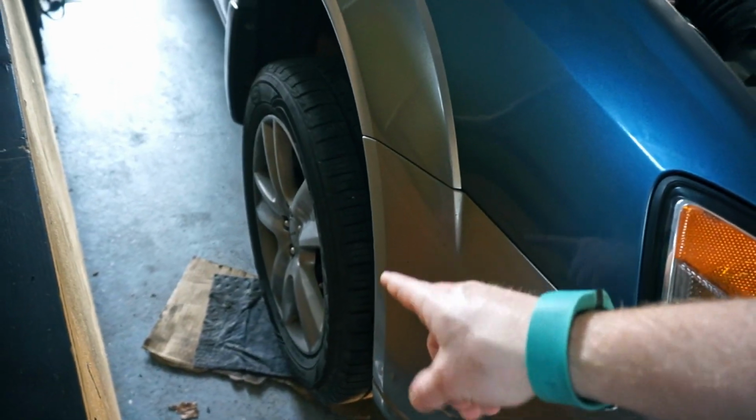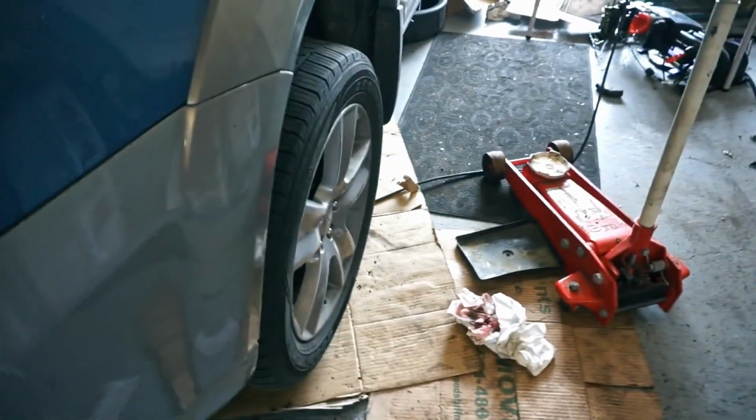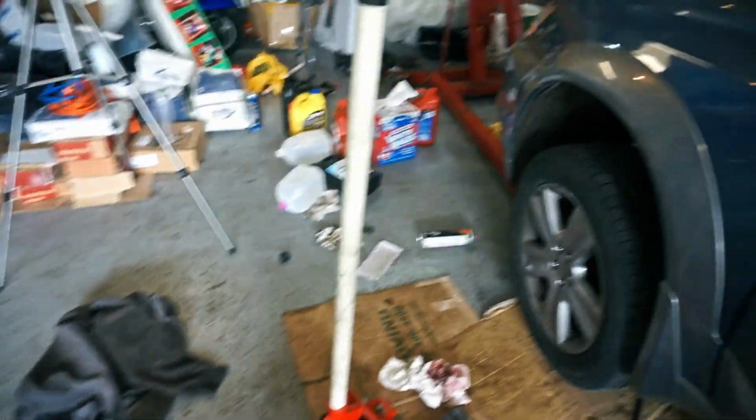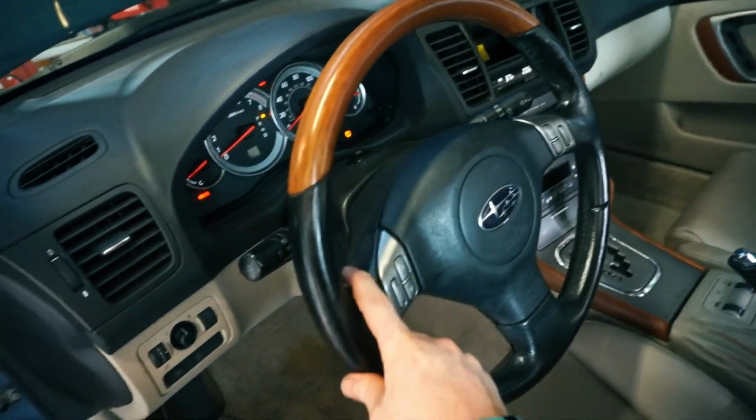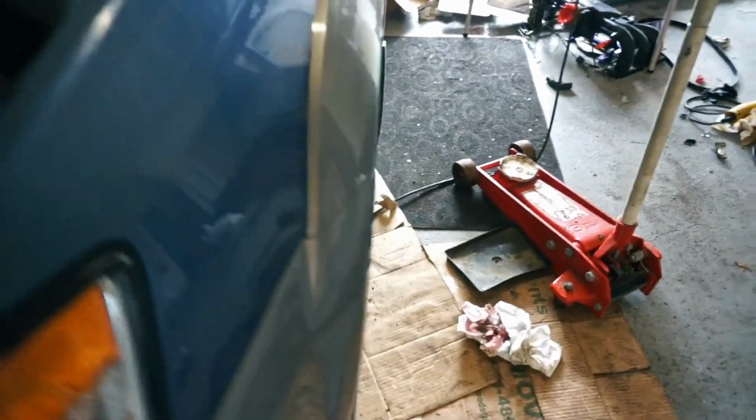I also did my toe alignment by eye, and it looks pretty good. Oh, that one doesn't anymore. Maybe I turned the steering wheel. Anyway, obviously, the other side is out then, because the steering wheel's off slightly. So I'm probably a degree out. I might mess with it one more time. That one looks pretty good.